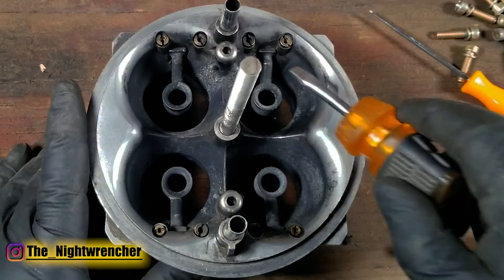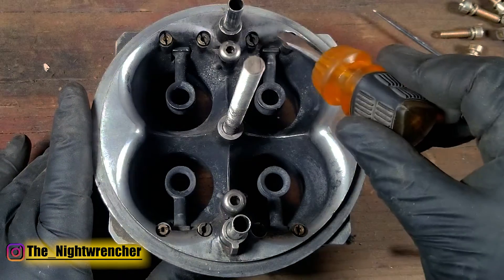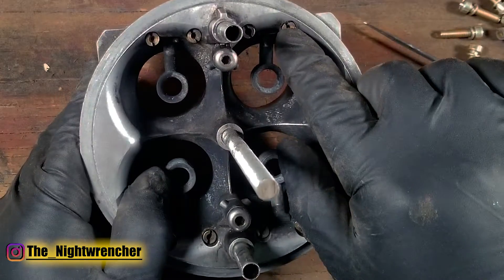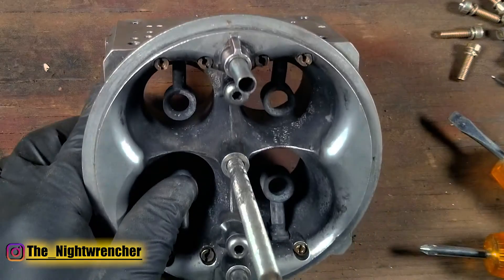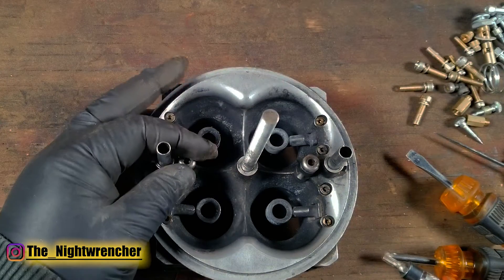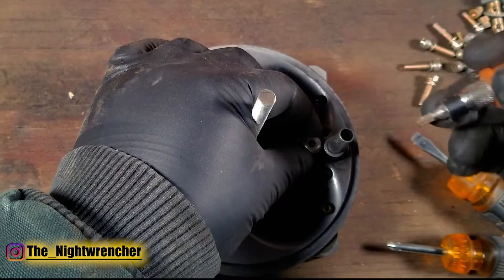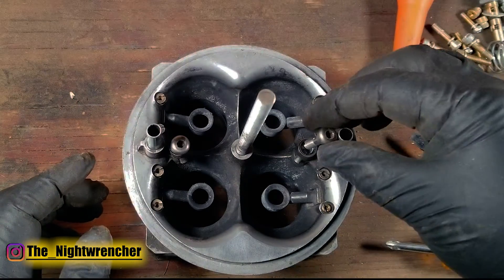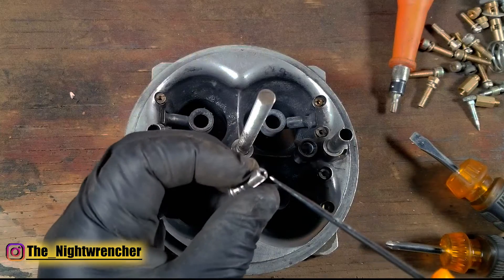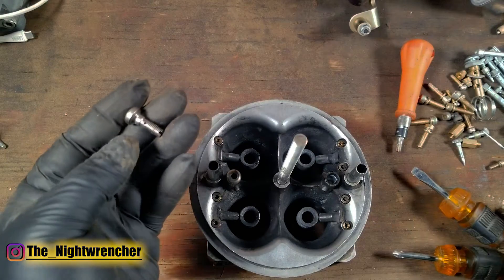On the main body, up on top there are brass plugs — these are the high-speed and low-speed air screws. Most carburetors on the market don't have removable or replaceable bleed screws, so typically you just spray carb cleaner through and verify fluid comes out the other side. Most importantly, check the accelerator pump nozzles. On the race series carburetor these come with high-flow screws, removed with a number-four allen or T25. The high-flow screws have holes and chamfered channels on the bottom that allow more fuel volume and faster flow compared to standard solid screws.